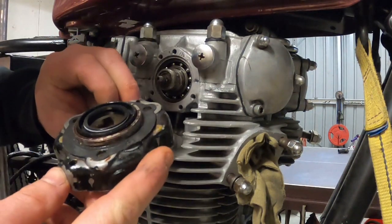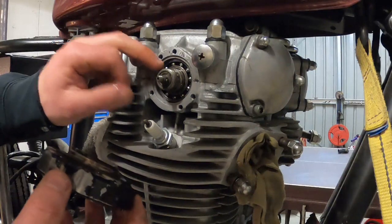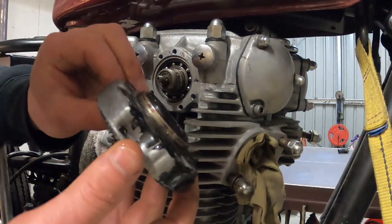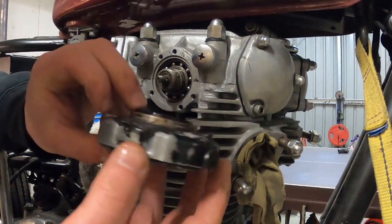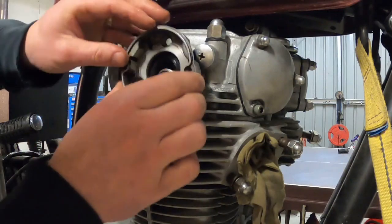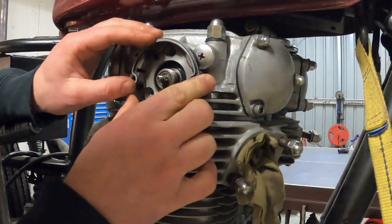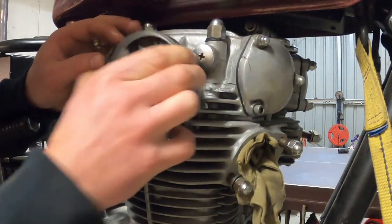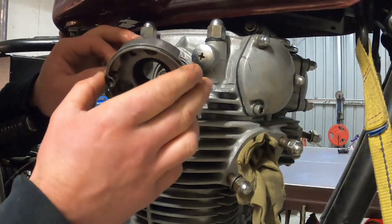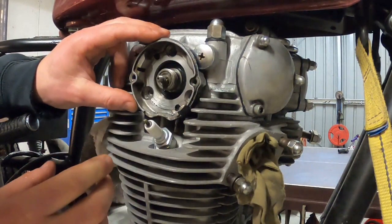All right, so when I drove this seal back into the housing, I think I actually drove it too far, because when I put it on the first time, the second lip was barely touching the camshaft contact area. So what I've done is I've just set it out from the housing a little bit. And now when I put it on, if I get it around the right way, the seal actually seems to contact the camshaft a lot better. It's not hitting anything that it shouldn't, so I'm just gonna stick with it like that. I think that'll seal a lot better.